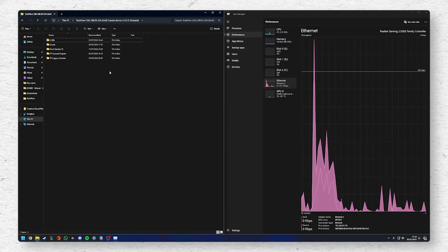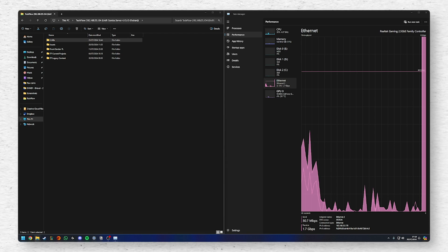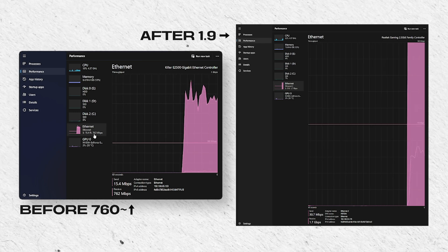Now I'll let you guys know the costs: the NIC inside this computer was around £30 on Amazon, the network switch was about £65, and the converter from SFP Plus to 10 gig ethernet was around £30 again — so we're just in at about £100 worth of equipment to upgrade from 1 gig to 2.5 gig. Let's drag the same folder across and see what happens. It works! That is night and day — the fact that this works and we haven't had to run any new cables. If you want to upgrade to 2.5 gig with some cheap networking gear, I'll put the links in the description.